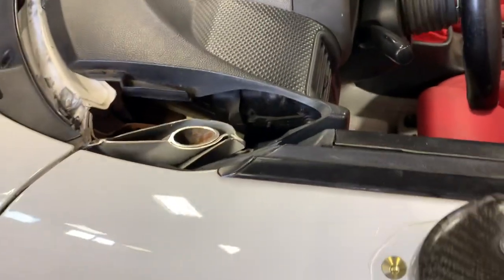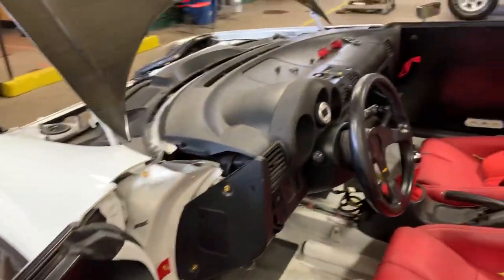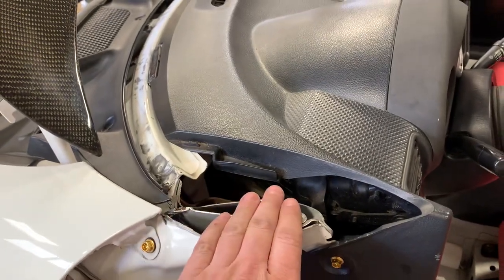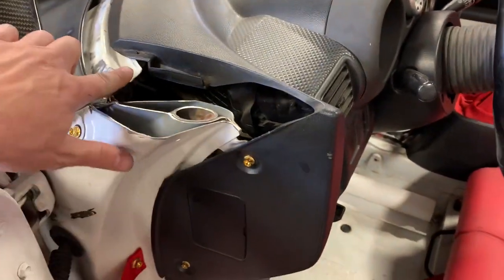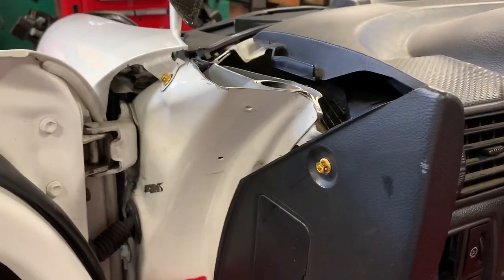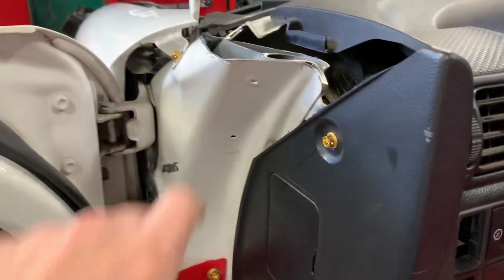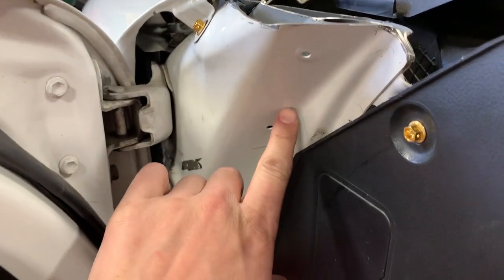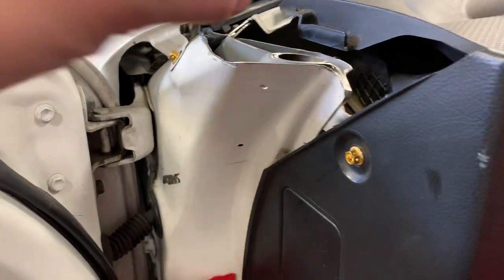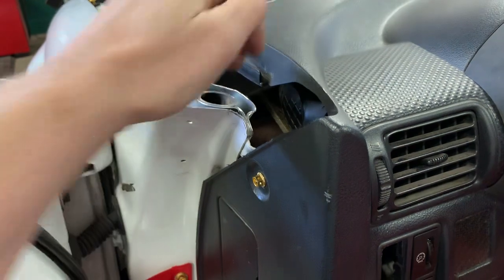People asking about barchetta conversion on their own car - this part where we cut it off, you weld in a little bit of reinforcement to get some chassis rigidity back. This tube passes down into the chassis and I'm going to drill and tap a hole into that, so I'll have a set screw that holds the tube as it slides down from where the old windshield was.